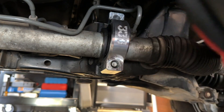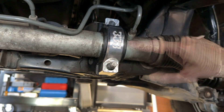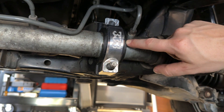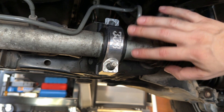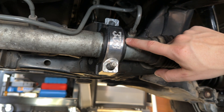This clamp is going to fit tighter than stock, so you may need a rubber mallet to fit it in place. Whatever you do, just don't use a metal hammer because it will mar the surface of the aluminum. It is recommended that you don't apply any lubrication to the bushing. Poly bushings are meant to be greased, but I wiped all the grease away — it is recommended not to use any lubricants when using this bracket, so be sure to keep this bushing dry.